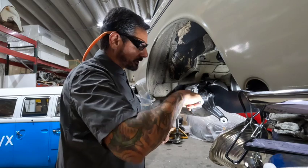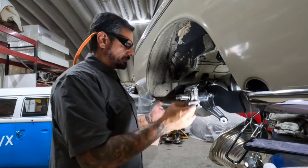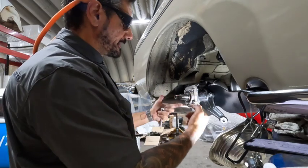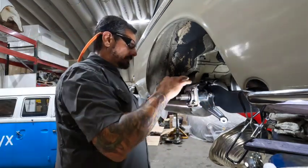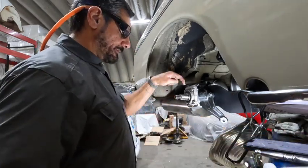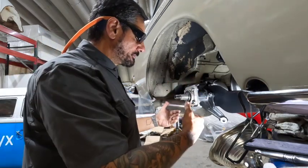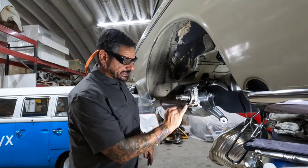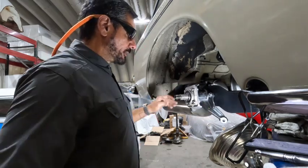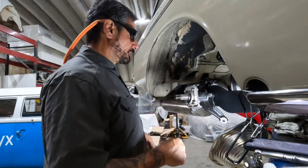We have a few things working in our favor with this application. The sealed bearings always help eliminate any leak from your axle circuit. The liberal amount of 1211 on both sides fills any void or gap in the brackets, housings, or cap. The way we machine this cap also helps tremendously - it gives a flat smooth mating surface butting up against the machined surface on the forged rear caliper bracket. If you're going to do disc brakes, spring for the forged brackets - don't get those stamped steel garbage. Forged brackets are the only way to fly.